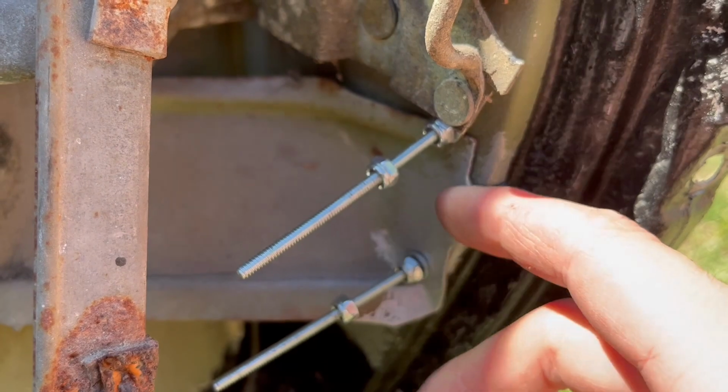So to fix all of your issues in life, probably, go to a hardware store and get the longest 6-32 machine screws they've got. I'd recommend just getting the longest size they have, which is probably about 3 inches, and then just cutting off whatever you don't need at the end. Also, treat yourself. Go ahead and pick yourself out a smattering of 6-32 washers and 6-32 nuts with the little nylon lockies inside of them.